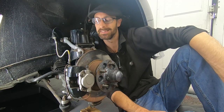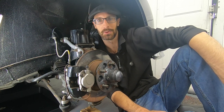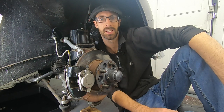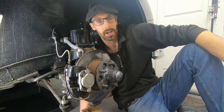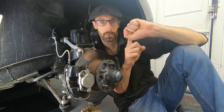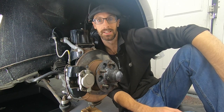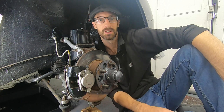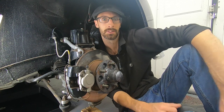Obviously getting our camera out has scared this away. Maybe I should just drive around with the camera on, but I don't think that's actually going to solve our problem. You'll just have to trust me that it's there. The sort of noise that it is — I've heard this before on other cars — I'm pretty sure it is this anti-roll bar bush here running dry. As the suspension goes up and down, especially sharply, the anti-roll bar tries to turn in that bush, and where it's dry it grabs and gives a really loud creak. Thankfully this is a super simple job — two bolts either side to drop the anti-roll bar off those bushes, put in some heavy silicon lube, bolt it back up, and away we go.